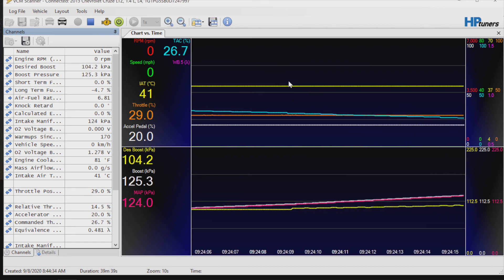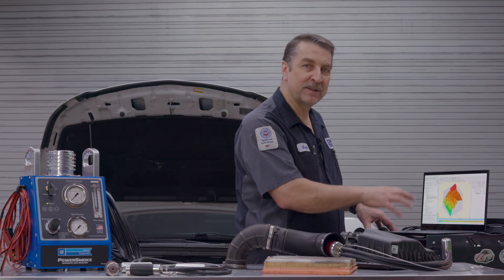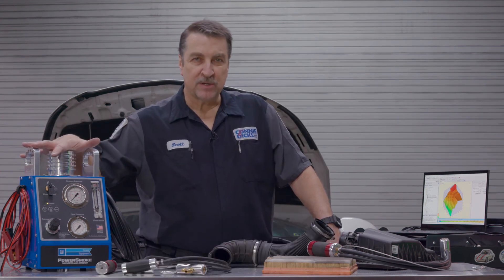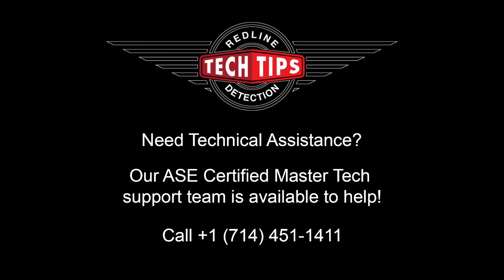Since a lot of these calculations are based on pressure, if you've got any pressure leaks in the intake system — whether it's under vacuum or under boost — it can throw this off. This is what can contribute to that P1101. So keep in mind that when you are using this pressure tester, even if you don't have the key on, you may have actually flagged some faults. You'll always want to go in and check and clear all the codes after you've concluded your testing, and then fire up the vehicle and go for a road test. I hope you found this interesting — if you have any questions or comments, just leave them below. Thanks for watching, I'll see you next time.